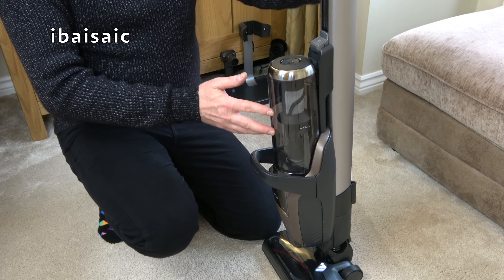The first result on the gauge will be the cleaner at minimum, then medium, then maximum. On its maximum setting this cleaner peaked at around 66 on the suction gauge, which I think is pretty impressive for a cordless machine. Of course, if you use it on maximum all the time you'll get limited run time and may reduce the life of the battery. In my experience of using many cordless cleaners, maximum is very seldom needed — I always find the medium setting is more than enough for day-to-day cleaning.